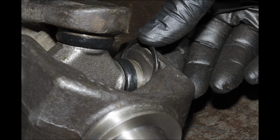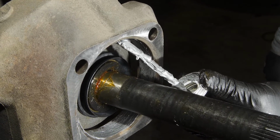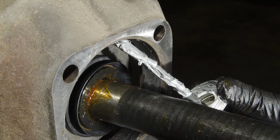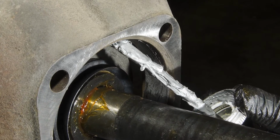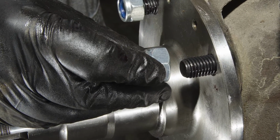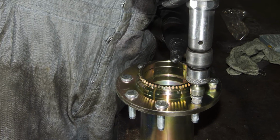When assembling the U-joint with the new axle stubs, be sure to install spacers if applicable for your setup. Clean the steering knuckle surfaces if they are rusty or corroded. Applying a light coat of anti-seize to prevent future rust is a good idea. When replacing the axles, be sure to support them and not damage the oil seals. Install the new spindles where the old unit bearing was, using the hardware included in the kit. Press in the new wheel studs.